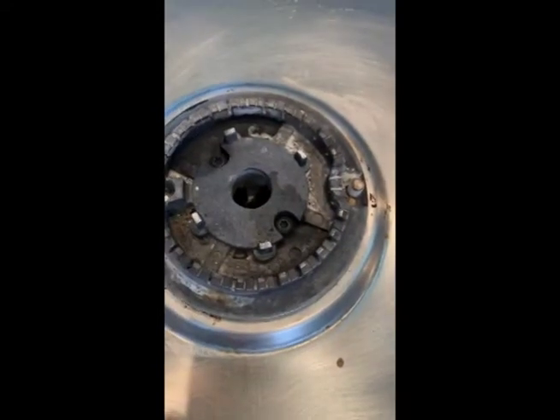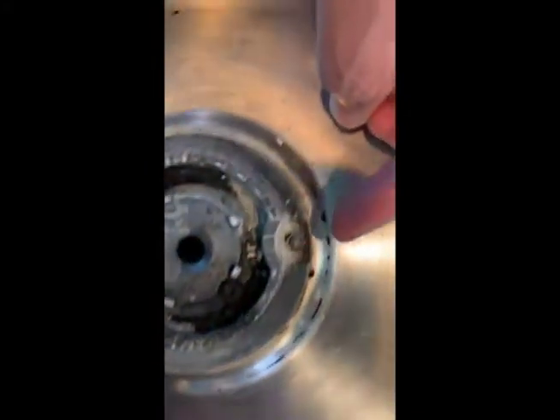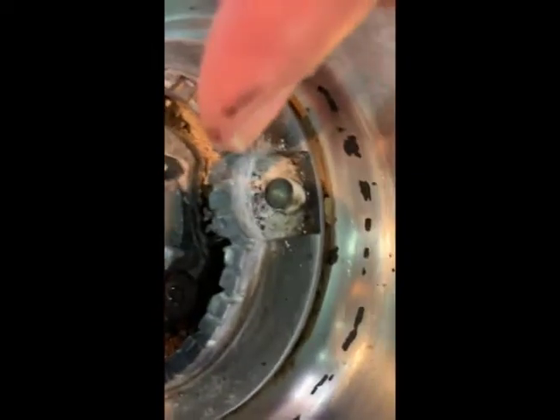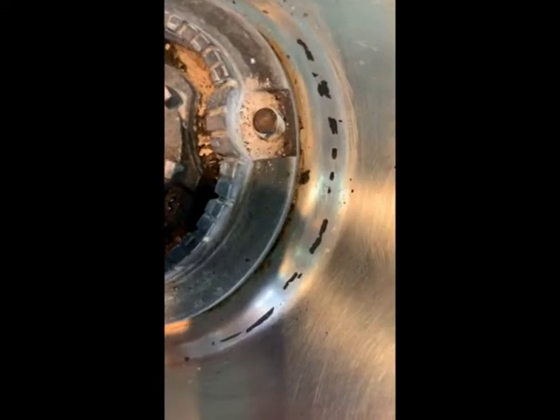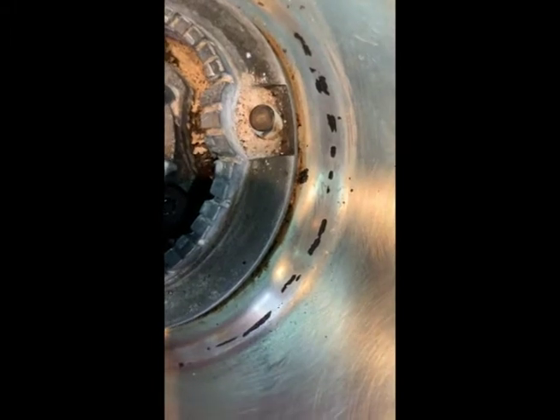This one is also firing correctly — this is the main burner. The other one has some plastic worn off from the bottom, so this is also not firing correctly. If you look closely, the spark is going down instead of coming up.